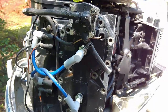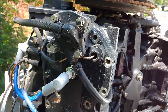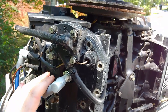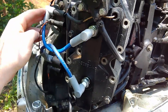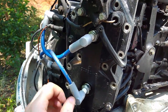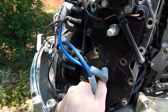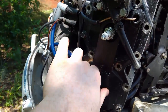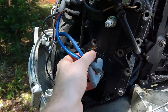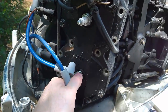The first thing we want to do is cut the battery off — make sure there's no battery going to the motor, so go ahead and turn your battery off or disconnect it. Then we're going to disconnect the spark plug wires. When you reconnect them, make sure you connect the top one to the top spark plug and the bottom one to the bottom. I twist my wires around to kind of hold them in place.